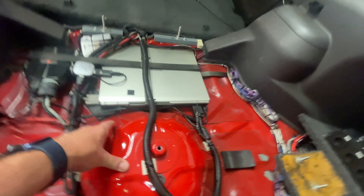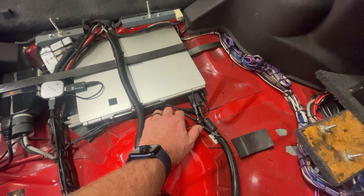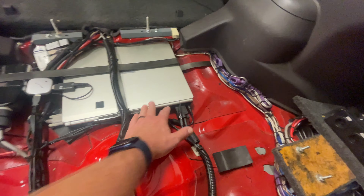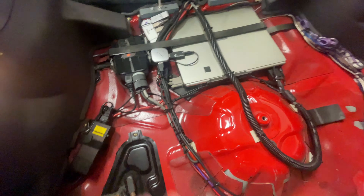This is the connection for the actual switch to turn it on. I had to disable the lid-close shutdown so it didn't shut off when closed, which wasn't an issue. Also notice how clean it is in here — look how clean that is, not rusted either. I'm going to start disconnecting things and use a process of elimination for what's blowing the fuse. As I plug stuff back in, if it blows the fuse, we'll see what's going on. Let's get this sorted out and then maybe we can even go for a drive. I haven't driven it all this summer and summer is just about over now. There's a lot of wires under here — I don't know if you've ever seen anything quite this wired up, but it's done right, I think. I put a red switch up there and basically wired it into the little switch here that turns this on. I soldered wires into this little membrane switch — it all unconnects.